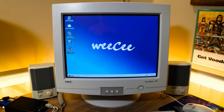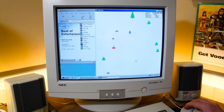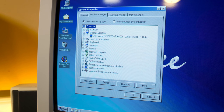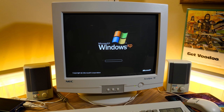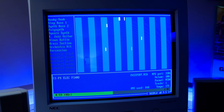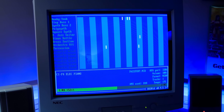At this point it's just your standard Windows 98 PC — and that's the beauty of this thing. There's no emulation options to set up or virtual machine variables to choose. The WeeC simply functions like any other late 90s PC, because that's effectively what it is. The Vortex 86DX processor is roughly equivalent to a Pentium clocked at 300MHz, so with its 256 megs of RAM you could actually run Windows XP on here if you wanted to, though that wouldn't be very practical for most games and software. Besides, quickly being able to start up and run DOS things — either in Windows or booted into DOS mode — is half the reason to choose Windows 98 in the first place.